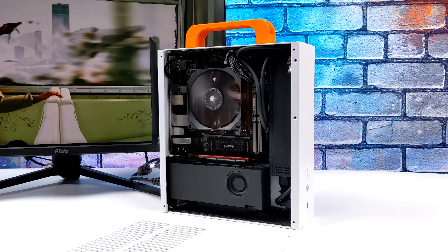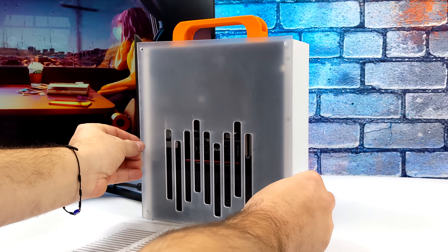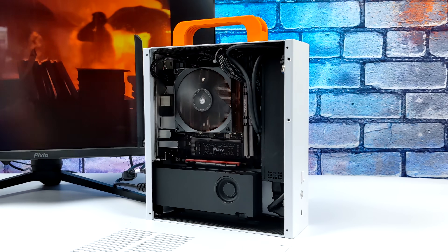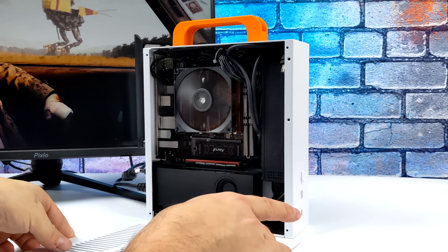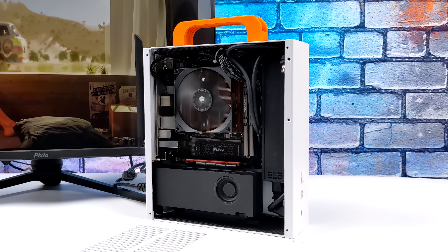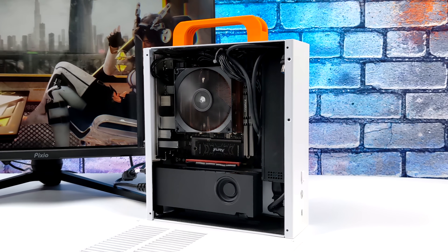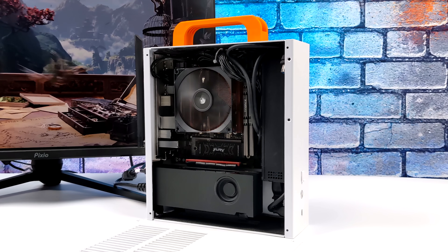So overall, I think the build came out really nicely. The maximum temperature that I saw while gaming was 86 degrees Celsius, and I believe that was with God of War. So it is getting on the warmer side, but we're not hitting thermal throttle while gaming. Maybe adding the acrylic cover would help out — it does have a little more ventilation. Or I probably should have added a couple case fans just up top, at least one pulling some air in or out. You could also take that steel cover and flip it around to the CPU side so it draws air right in over the cooler. For a first run with no extra case fans, not bad at all. Didn't hit thermal throttle under everyday normal use and gaming, so I'm totally fine with the way it's set up right now. Noise is very minimal with this system. I didn't go into the BIOS and adjust the fan curve, but I think it's working out pretty decently.